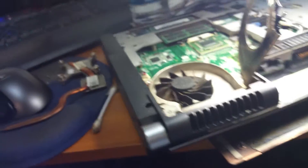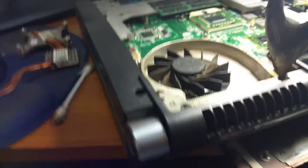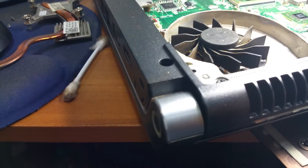You've gotta blow it out — I tell people all the time. All it takes is a few seconds with a can of air to prevent this and to keep the thing from breaking apart. You will save a laptop. This is a pretty nice laptop — a Dell XPS. I think it's got the AMD chip; it looks like an AMD Athlon X2.